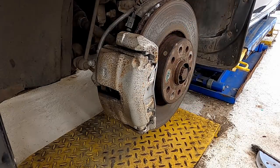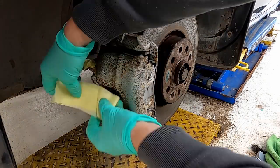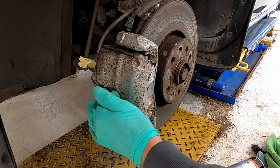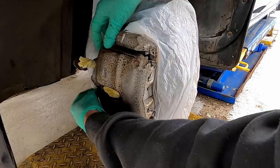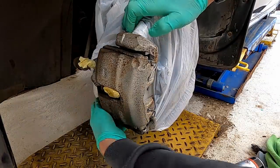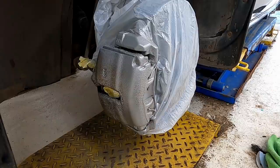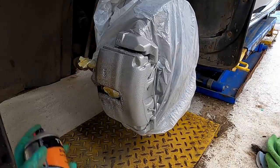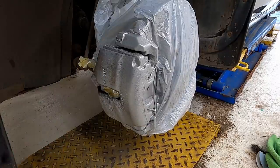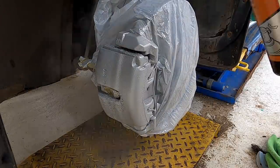With the surface area prepared - and I use that term loosely because this is a quick tidy-up job - I can now look at masking out this area. I'm going to put a little bit of masking tape around the bleed nipple and also where the piston goes into the caliper. I'm not masking where the spring clip is or the back of the brake pad, purely because it's already covered in paint and the vehicle is going to receive brand new discs and pads in the workshop afterwards anyway. In the accelerated footage it looks like one big coat of paint, but actually you dust a bit on, leave it for a little bit, come back and spray a bit more, building up the coats slowly. I'm also using a high-temperature paint because brakes get very hot in use and it won't burn off.